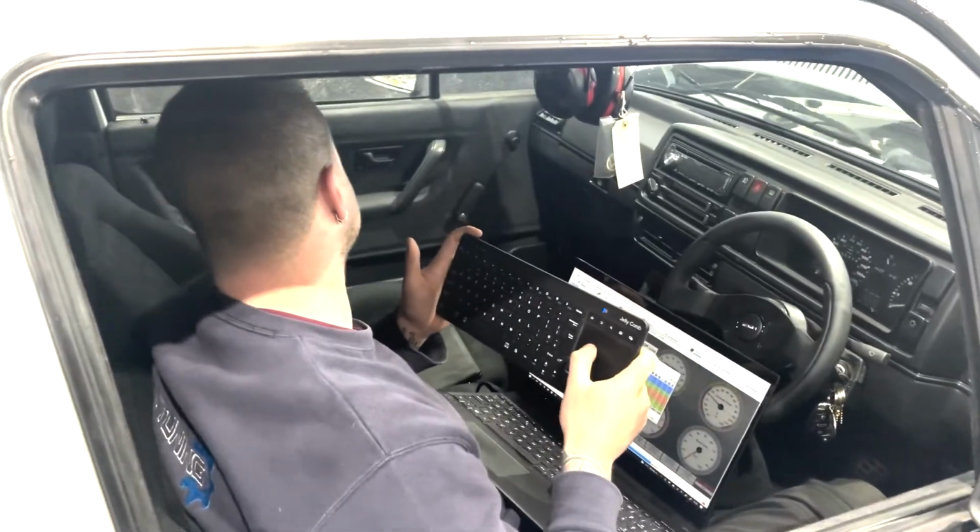We talked about the power delivery as well, but considering there's a couple of guys working on it DIY, it had done pretty well. Timing profile was safe. Fueling was rich, but still safe. It's 33 horsepower, 50 newton meters, it's good, we'll take it. Not been a bad day, to be fair. Yeah, nice. It did well. All right, hopefully to be resumed.